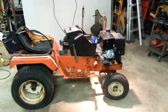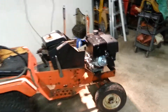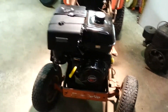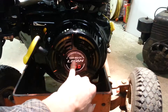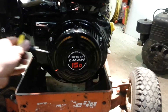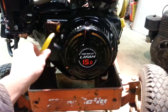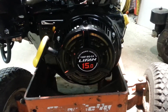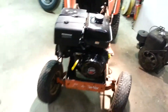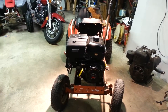The reason I chose to put the engine in this way: if I had gotten an electric start version of this engine, I would have been able to make a flywheel adapter for it. But with a recoil start like this, I have to relocate the starting mechanism by one means or another, so I figured this would just be easier — and this way it will fit under the hood to some extent with minimal modifications.